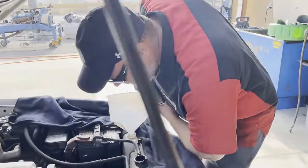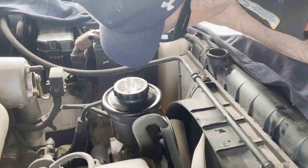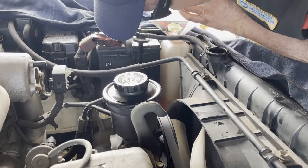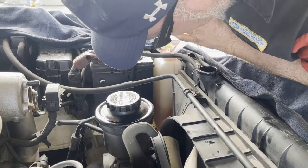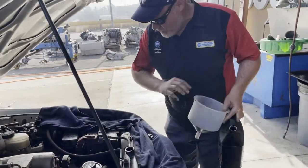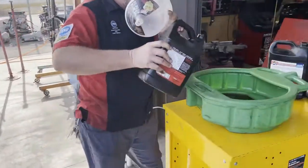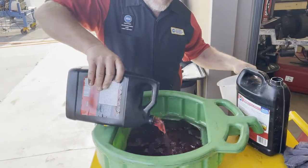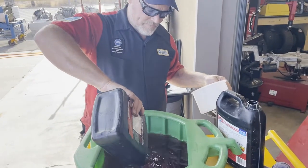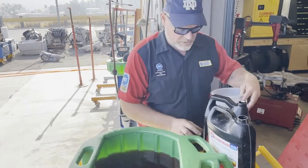Using the air refill tool, I'll use the drain bucket. The first thing to fill is the reservoir — watch the side, it has a fill line. Bring it up just to the full mark; some have a full hot and full cold mark. That looks good. Put the cap back on and pour the rest into the bucket we'll use for filling.